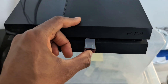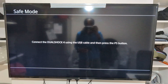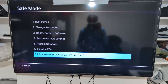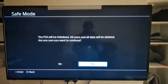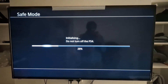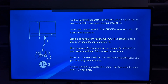Plug your USB into the PlayStation, then press and hold the power button until it flashes two times to enter safe mode. On screen, the only option available is to reinstall the software since this is a brand new drive. Click that, move to OK, then click Yes. It says the PS4 will be initialized and all users and data will be deleted - you have to do it anyway. Once this finishes, you'll be back in the PS4 operating system and can log into PSN and download your games. And here we are - we're back in the PS4 OS. Thanks for watching.